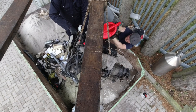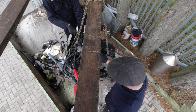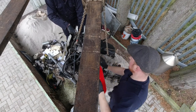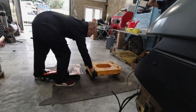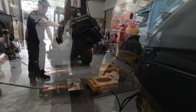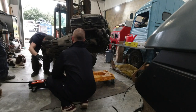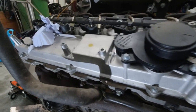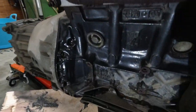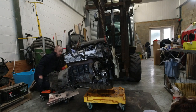The van was so down on power — I think the turbo's gone on it. The main thing is the salt's off. With the engine now scrubbed up and shed of its salt, oil and road muck, we can now bring it in and start pulling that gearbox off to see what the clutch is saying. We're also going to give it a good checkover, whip off items like the alternator and turbo — because these things are just asking to be smacked off my fresh paint on the way in. And we're swapping a lot of these auxiliary bits over anyway, so whilst the engine's just here floating around, we'll make life easier and do it all here.